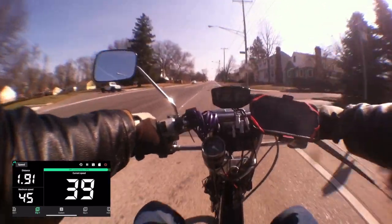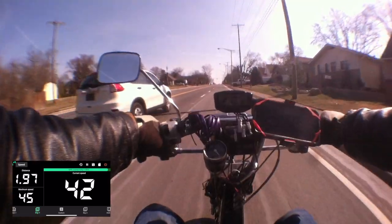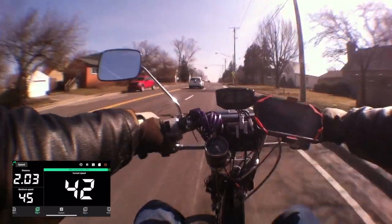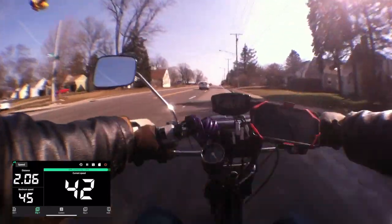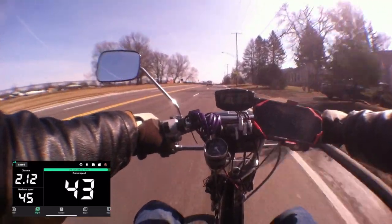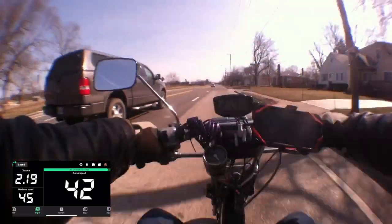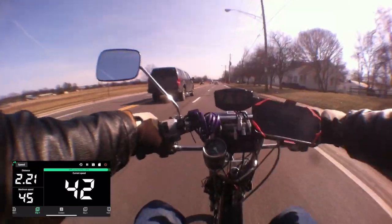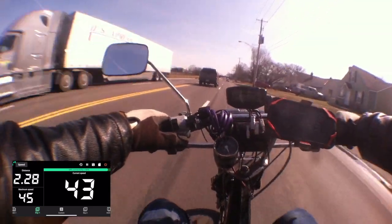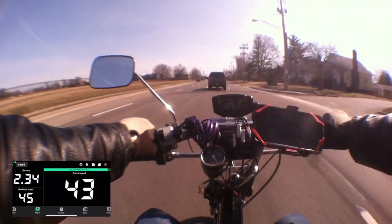But anyhow, this bike really runs nice, and I'm sure there are going to be some inevitable comparisons to the Blue Urban Express, which has got the DR kit, is the main difference between the two bikes. And it's got a VM20 carburetor as well, so a slightly bigger carburetor. The main difference between these two bikes is the Blue and Silver Urban Express is heavily restricted with this zero turn mower air box, air cartridge thing.